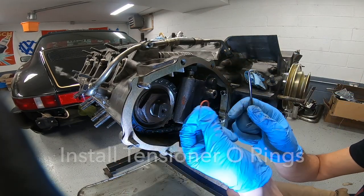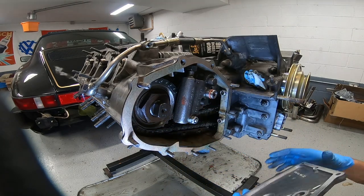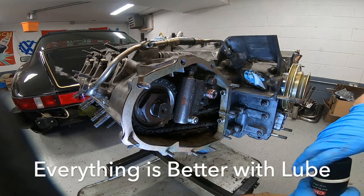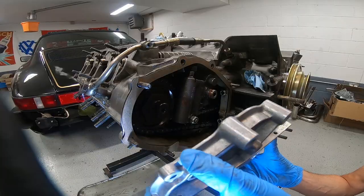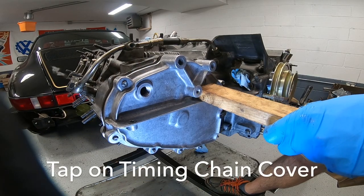It's really important that you don't forget this o-ring, otherwise you're going to get leaks right where your cam line runs in. Wayne's book also says to put a little bit of assembly lube on it.